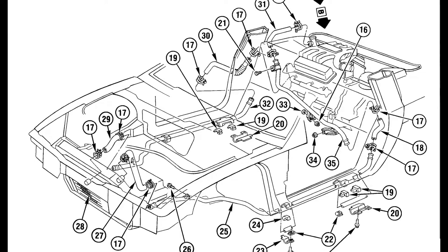With the engine in the back of the Fiero and the radiator in the front, you can see from the diagram that the coolant system consists of a lot of parts. There is a cap on the manifold of the engine that holds a thermostat. When the engine reaches operating temperature, the thermostat opens to flow hot coolant from the engine into a piped system that brings coolant up the passenger side of the car to cool in the radiator. The radiator then has an outlet pipe system that brings the cooled coolant back to the engine on the driver's side of the car. There is also an electronic thermostat system to operate the radiator fan.